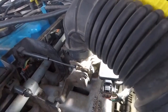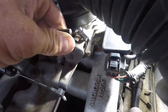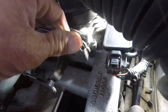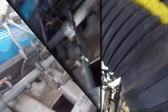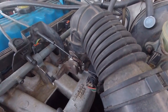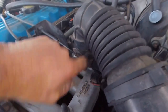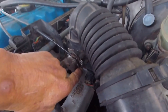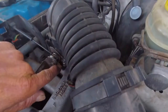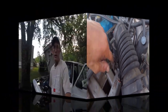I got the hose clamp on there — I'll show you on our side what it looks like. That's going to give us just enough shim for about the right idle. Let's crank it up and see what it sounds like. It's idling pretty good right now. Move it up as far as you can to keep any overlap from getting in between the screws — you don't want two thicknesses of that hose clamp in there, it'll be way too high.